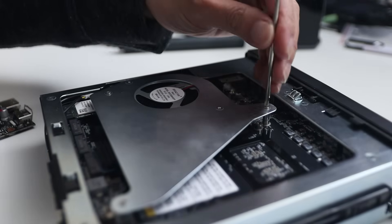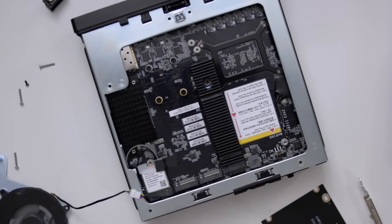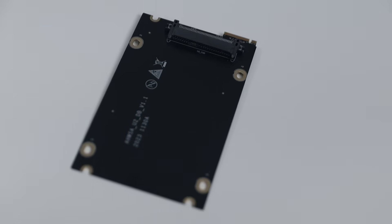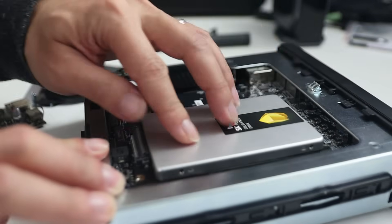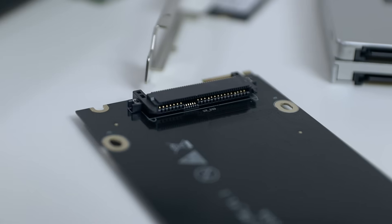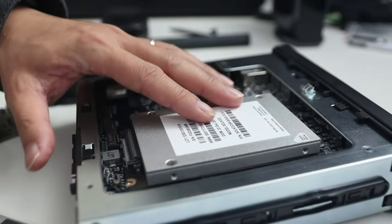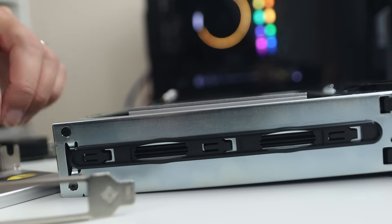Flipping to the underside, you can see a large bracket that houses a fan. Underneath that bracket are three NVMe slots. The one closest to the middle is PCIe 4, and the other two are PCIe 3. This mini PC also includes an adapter that allows you to use U.2, which means you can use enterprise-grade drives. The difference between a standard SATA SSD and an enterprise drive is that the enterprise drive has additional pinouts in the middle notch. Unfortunately, due to height constraints, I wasn't able to fit my enterprise drive — it was just a couple of millimeters too tall. If you're planning to use enterprise drives, you do need to be mindful of the height.